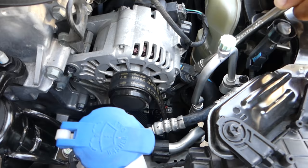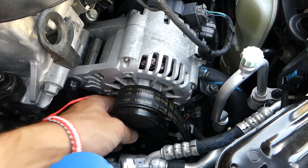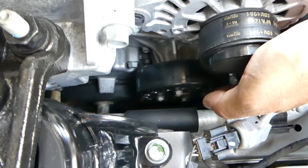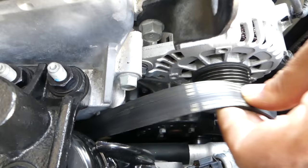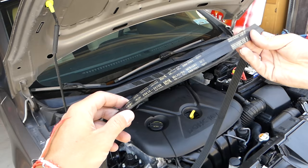Let's see if that will be enough to slip the belt off. It comes off the alternator or the water pump — it will come off the water pump like that. After that you just pull it out of the way; it'll get stuck on the bottom. And this is the serpentine belt out of the car. We'll have links for the parts and tools we use in the description of the video.